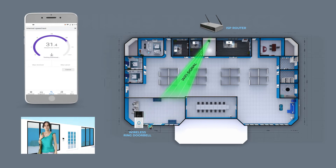Our only concern is the upload speed, so you can ignore the download results. Ring's website states the optimal performance for most of their devices is 2MB a second upload speed. Their tech support confirmed for us that the same goes for their Ring Doorbell 3, with a minimum speed of 1MB a second. But throughout the day your Wi-Fi speed can fluctuate, so more upload speed is obviously better.